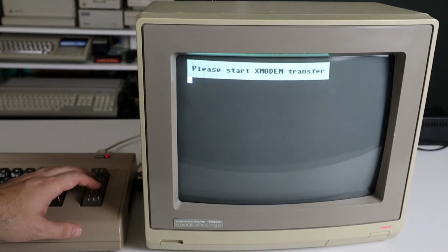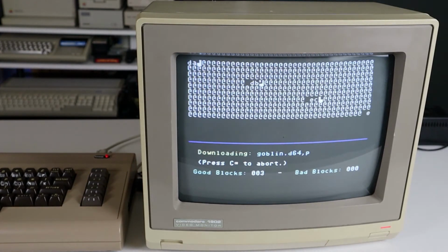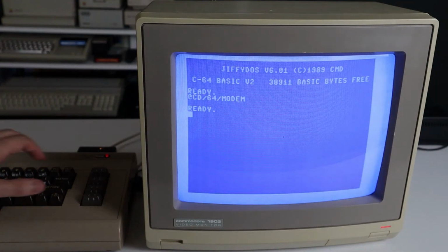In episode 4, I demonstrated running ccgms term from outside of a disk image and downloading a D64 directly to the SD card. It simply isn't possible to do this on other devices that emulate a 1541 because they cannot operate outside of a disk image, and it's not possible to download or use a D64 from inside of another D64.